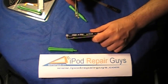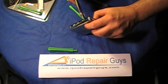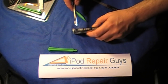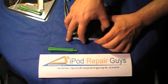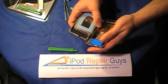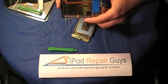Then you need to go back over to the other side, work your way around the headphone jack, and again down the side of the iPod to dislodge the locking clips. And finally, with the clips dislodged, you're able to pull apart the two halves of the iPod Classic without doing very little damage to the iPod Classic.